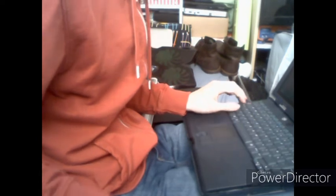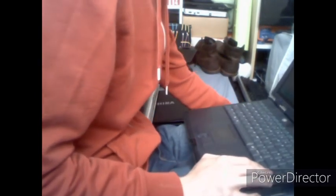So mine turns on. Press the F2 key, get into the BIOS, and if you have disconnected the BIOS battery, redo all the settings, which in my case, I might have dislodged something in the battery, so mine has all reset. So reset it all up to the modern date and time. So in my instance, it would be 16th of January, so that would be 01/16/2022, and the time is currently 13:09. Don't forget about the seconds, it'll only make it at least a minute fast, or such.